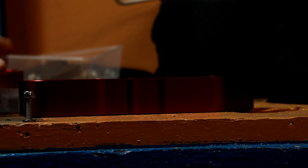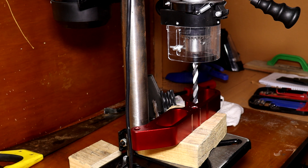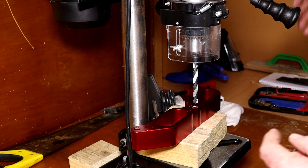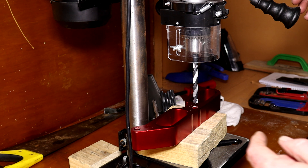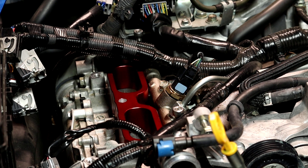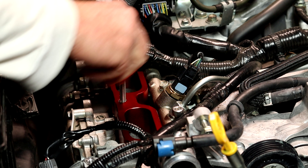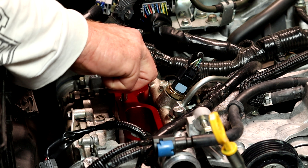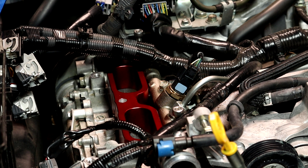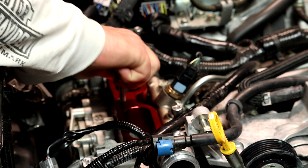Now I'm just going to drill out this hole so the fitment is a lot better than it is at the moment. This hole is 9mm — this is a 9.5mm drill — with the drill set at about 830 RPM, which is probably a little fast, but it is aluminium and I'm not taking much. I don't have a vice, so we'll see if I still have a hand at the end. That's the 9.5mm drill through that hole. The other two are in and lining up quite nicely with the ports in the cylinder head. It's tight — not quite close enough — so I'll run the 10mm through. There we go.